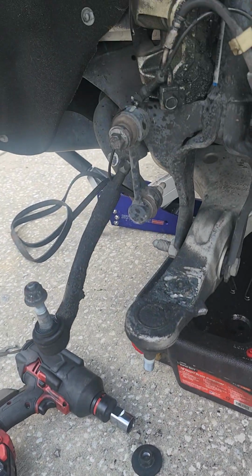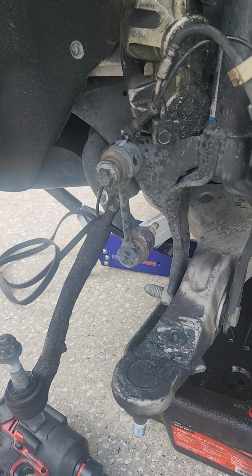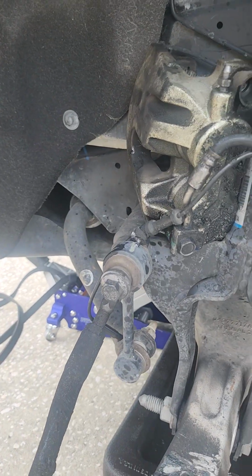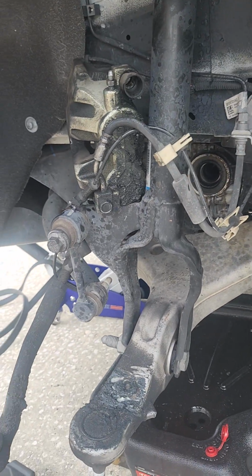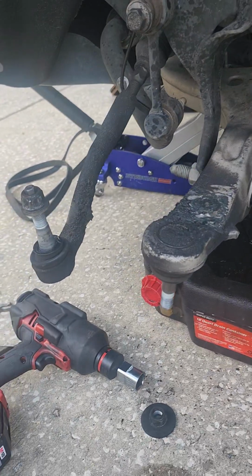So if your brake pads are wearing on the outside only and not the inside, that's usually hardware related. If it's the inside only, that's usually a failed caliper piston. This is a dual piston system, so it could have been recessed. They didn't do the brake flush, which we did do today.